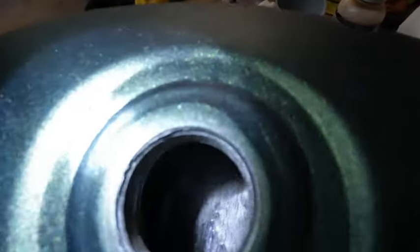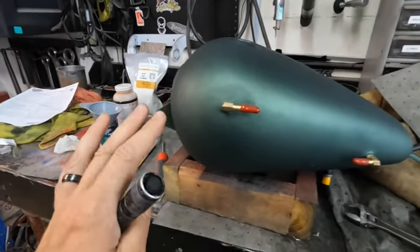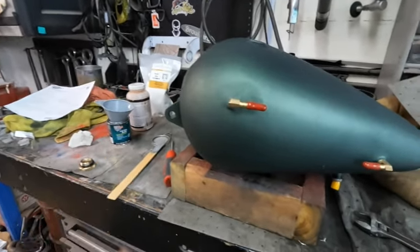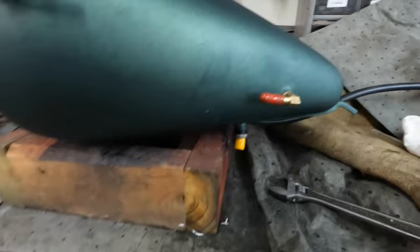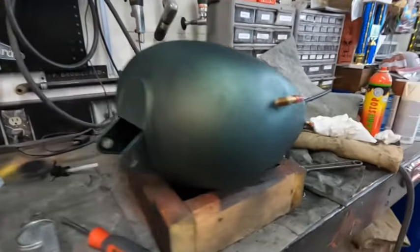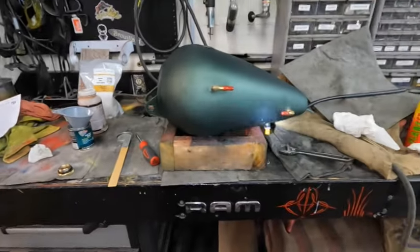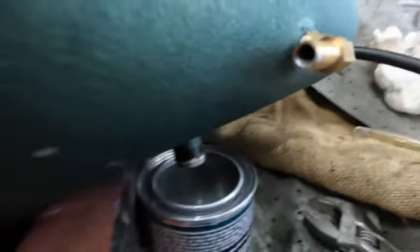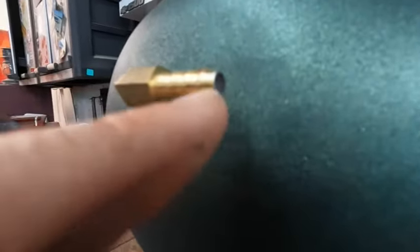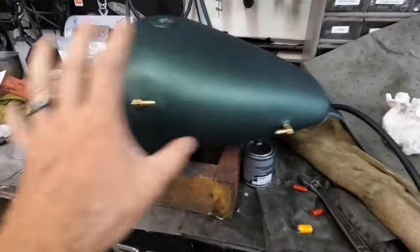Update: we've been rotating this for about five minutes and we've got a nice uniform coating in there — everything is all silver. Now that we've got it coated and rotated — you want to be thorough, this is important, large tank same difference — take your low spot and drain off any excess. We'll pull that out, put the can back under there and let any excess drain off. Then we're going to let this thing sit for four days. We've got a coating all the way into where our sight glass is. To make sure the ports aren't clogging, I'm going to put a tiny bit of compressed air through just to keep the ports open. We'll go ahead and let this thing cure overnight and see what it looks like in the morning.